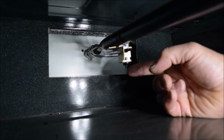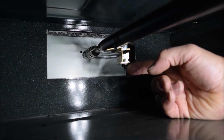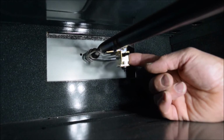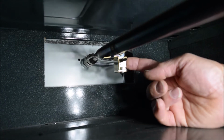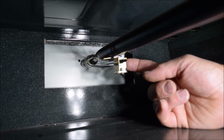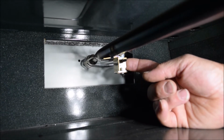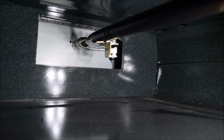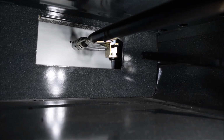Okay, how to light the pilot light on my RV oven. You see where my finger is. This is the pilot. So I'm going to put flame on this for 15 to 20 seconds while I push in the oven control knob at the pilot setting. It just lights right up. So you should be able to hear the gas start to flow.